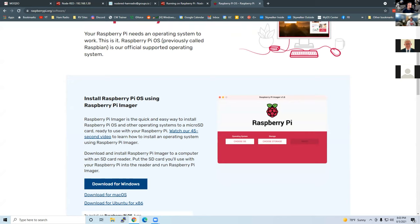And it will literally ask you, what are your wireless credentials? What's your wireless SSID? Or if you want to put it on the network, if you want to give it a static IP, I think that is all built into this imager. So you get an SD card that's probably 8 or 16 gig, which is probably the least you can get. And I would get a decent one, probably 10 or 15 bucks. It's a SanDisk. It's a good brand name because you're going to be doing a lot of reading and writing